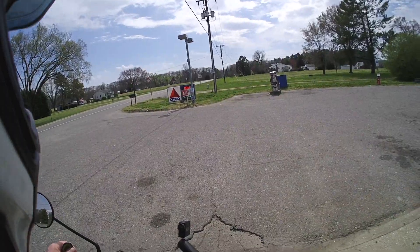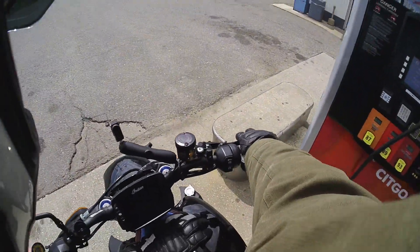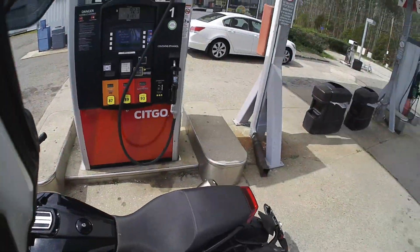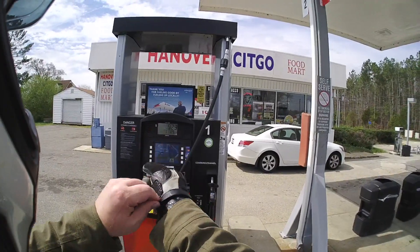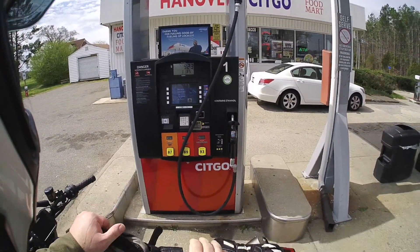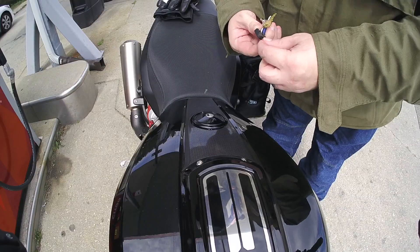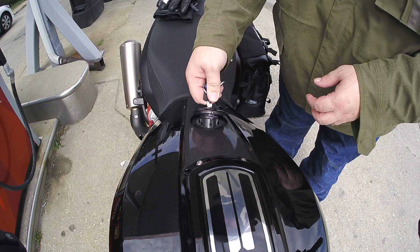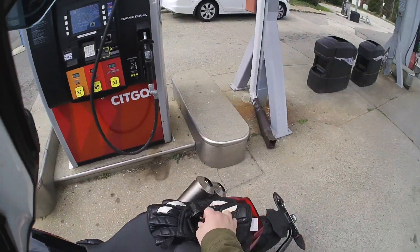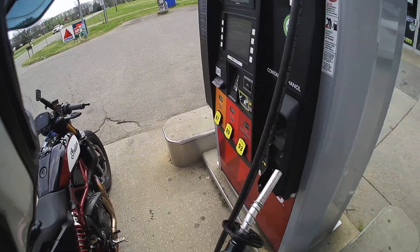I'm going to turn off the bike and get around to putting the gas in it. You have to use the same key from the ignition in the gas cap. Put the bike on the side stand and I always put my gloves on the back part of the seat. Then I'm going to use the key to get the gas cap out and put the gas cap on top of my gloves so that I don't lose it. Put the key in gently, turn the key counterclockwise. I usually have to wiggle the gas cap just a little bit, and then I take it out slowly in case gas has splashed up on it.